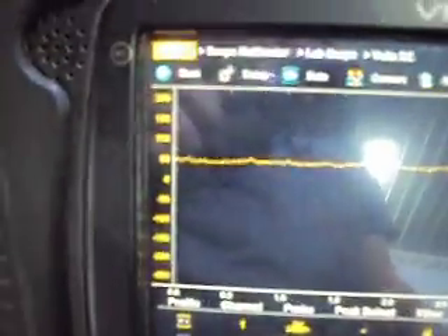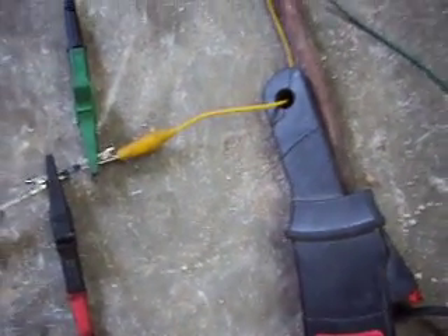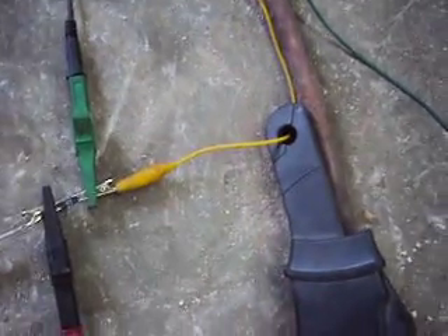Right now I've got that hooked up and we're showing about 50 milliamps draw from the test light. But I tested it before through the Vantage's built-in amp meter, and it was actually closer to about 83 milliamps. So right away you're off almost 30 milliamps by using this, and I did zero it out. This thing is so sensitive that even if you move it a little bit, you'll start seeing variations. I just don't think of the amp probe as a very good way of measuring parasitic draw. It's one way to do it without interrupting the circuit, but even to use the amp probe, you're still pulling fuses out.